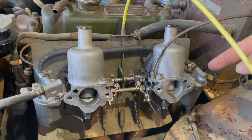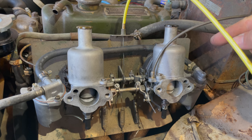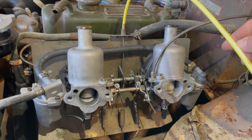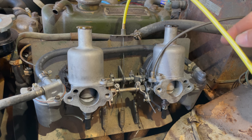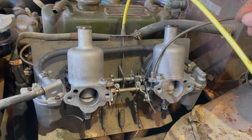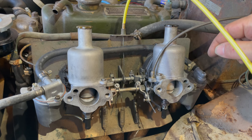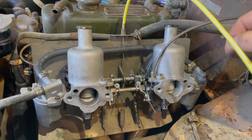The next step is to take it for a drive — don't put your air cleaners back on yet because you're probably not done fine tuning. Just because the carburetor settings look right and the car starts and runs doesn't mean it'll be great on the road. You may need to adjust things a little leaner or richer than you expected. Every car is a little different. I'll take the SU wrench and a screwdriver so I can make adjustments while out on the road.